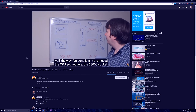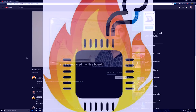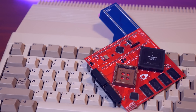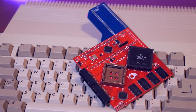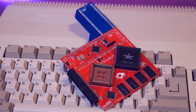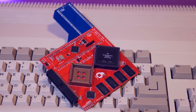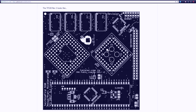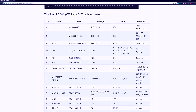Stephen Leary, also known as Terrible Fire, has designed a completely open source Amiga 500 accelerator called the TF530. My card is the second revision and features a 68030 accelerator clocked at 25 megahertz, an IDE header to add a hard drive or compact flash device, and two megabytes of fast RAM. The TF530 can be built from parts if you know what you're doing, and many people have already built their own from Steven's work.